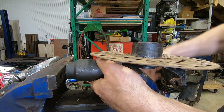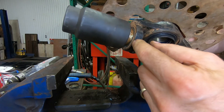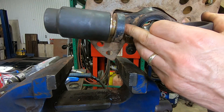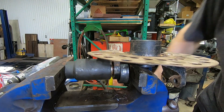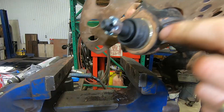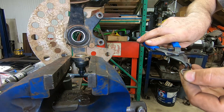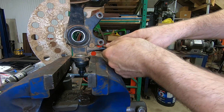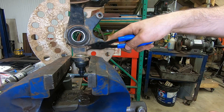That's probably all I'm going to get before I'd bottom the ball joint out on the bench vise, so I stopped before it bottomed out. To press it the last bit, I've got a cup out of a big ball joint press kit — put the cup right there and let the ball joint press into it. There should be no gap between the ball joint collar and the shoulder — that means it's pressed home all the way. Put the snap ring back in place with goggles on; when you roll it, you want to see it go underneath and seat properly.